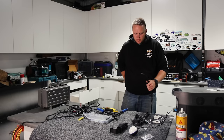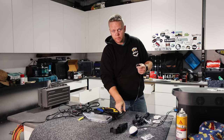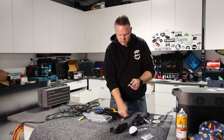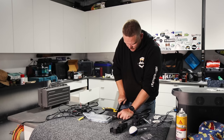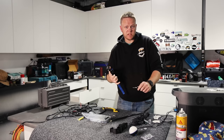So you have to remember with thick cable, you can't sort of twist it into position where you want it. So you want to try and get the lugs in the right position. For me, this one's going to sit that way, wrap around the battery and then go to the other negative. So I'm going to want to make sure I put my lug facing the right direction down, so I don't have to try and twist it into position at the end of it there. Obviously that sort of lines up nicely with the end of the sheath for the protective cover. Goes on, go to my 35. For this sort of thing, one crimp's enough for this size of lug anyway. Just having said that, I might do one just from the other side.